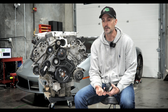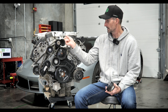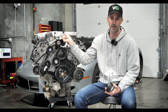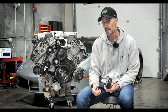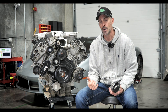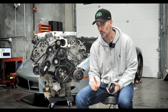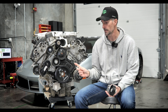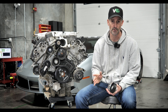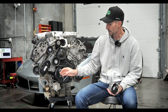You're asking the belt to work harder, push more air, and create more load through the supercharger. It means that if any part of that system isn't operating correctly or is marginal, you're going to start seeing belt slippage. We first started detecting belt slippage on the 1900 engine superchargers on the 5-liter engines when we were changing both pulleys.